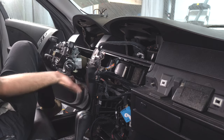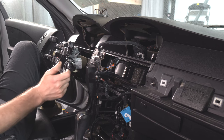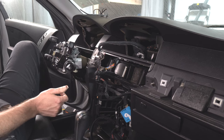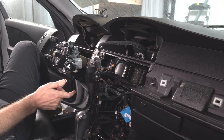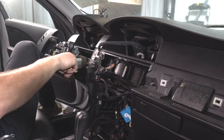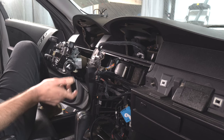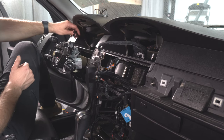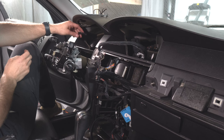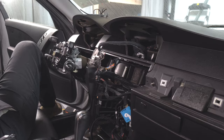So I've got the steering column back in. So that's accessory, and I heard a couple clicks. Now there's on, and I heard some clicks. There's start, and that's not doing anything. But yeah, I could definitely hear fuel pump and other things turning on. The next thing I need to do is wire in the new connector, because they cut this one. So wire in the connector, put all the dash back together, and then I think we'll be good.